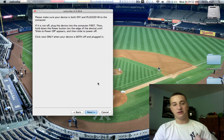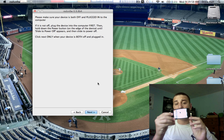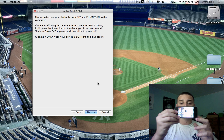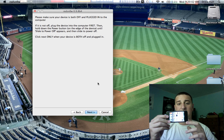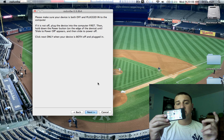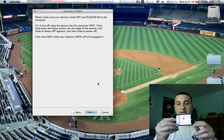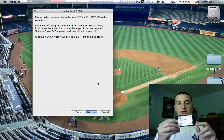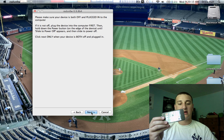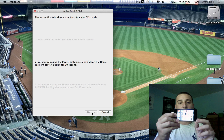At this point, you want to put your device into DFU mode. To put your device into DFU mode, hold the power and the home button at the same time for 10 seconds, and your screen will turn black. Then release the power button and keep holding the home button for another 15 or 20 seconds, and it'll automatically kick into DFU mode. Right here, hit Next — it gives a good countdown for you.